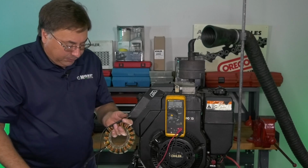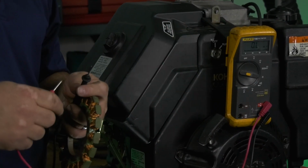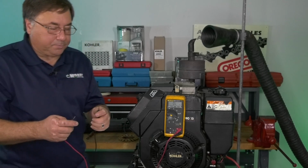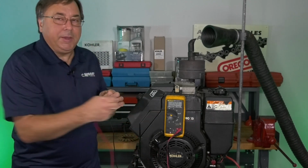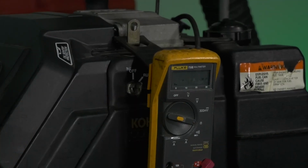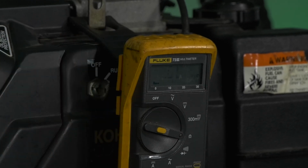One thing that a lot of people forget to do is measure the resistance of their terminals. What kind of reading do we get there? Subtract that number from the reading you get when you're going across the two terminals. Another thing people often forget. When I'm grabbing these terminals alone, I am getting a reading. Some people would look at that reading and say, man, that's 131 ohms, Brian. They forget to look at the little bitty K on the right-hand side of the meter. Now that K could be the right side, could be the left side, could be an M, that's meg ohms, K ohms, thousands ohms. You take that number times 1,000.